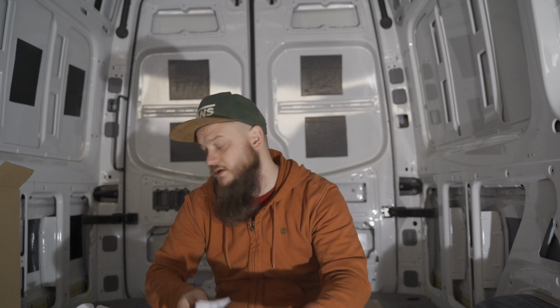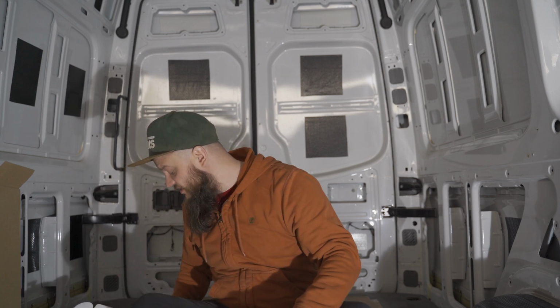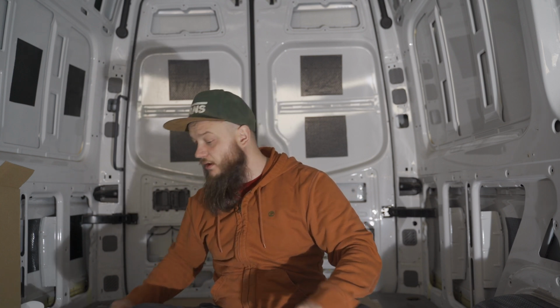Yesterday 3 windows arrived. I went for camper van windows instead of the nice looking bonded windows, but there's a couple of reasons with that. They're a little bit easier to finish off around, but they're much harder to fit from what I've seen so far. Not attempted that, but I've done the bonded windows and they're very straightforward. Just cut along the lines, apply a bonding sealant, well, not a bit, a fair bit, put them on, hold them for 12 hours, that's about it.